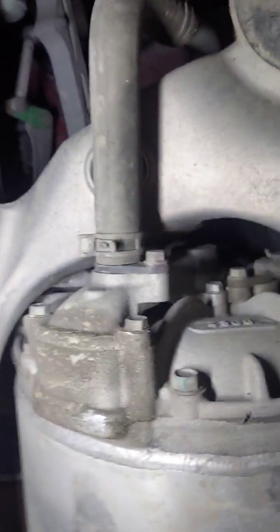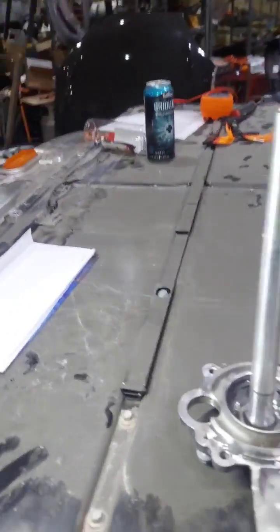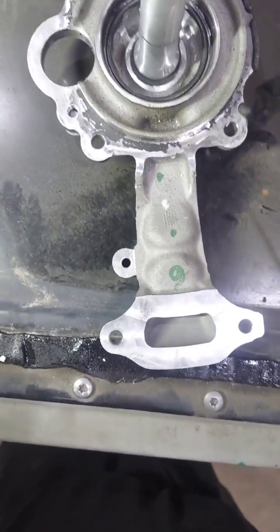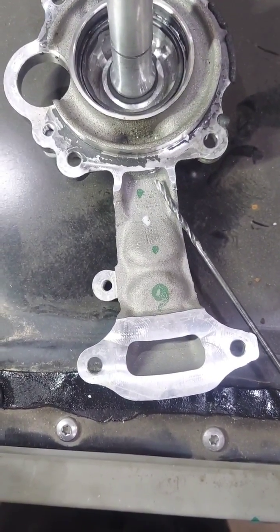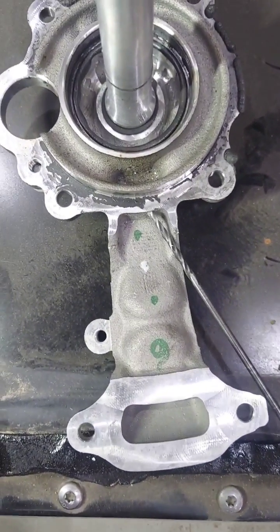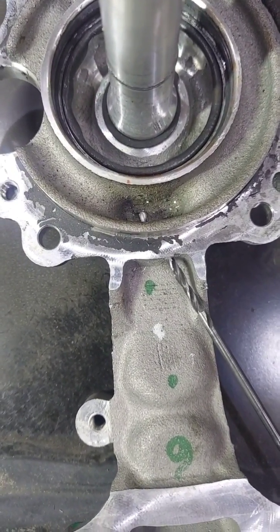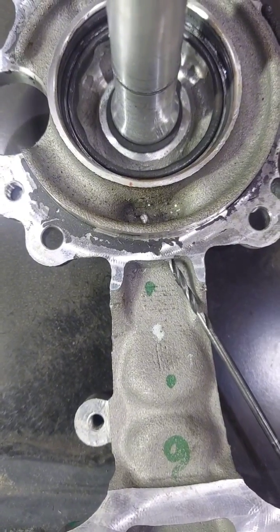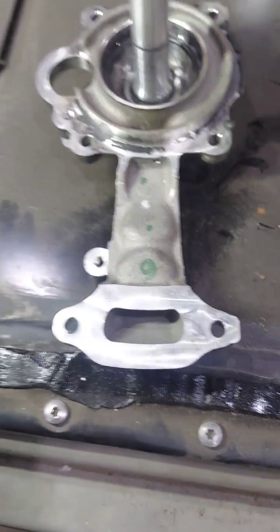It's really not visible, so you've really got to do it by feel. To give you an idea, this is what you're drilling into — this is the coolant manifold for your rotor delete. What you have to do is go in with your drill bit and put some deflection on it to get it to start drilling in that area without walking. And then once it goes through, you have to quit. If you go further in, you're going to cause major issues. So just through that first layer.